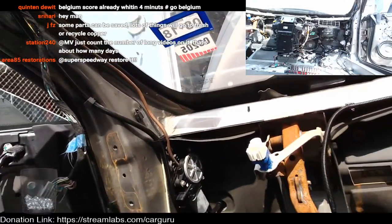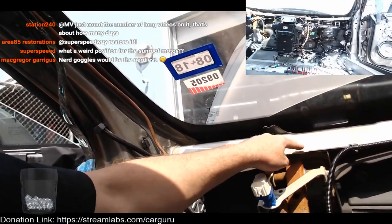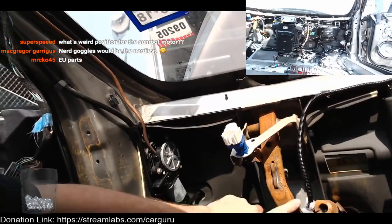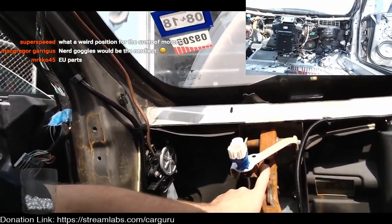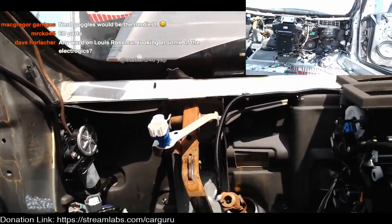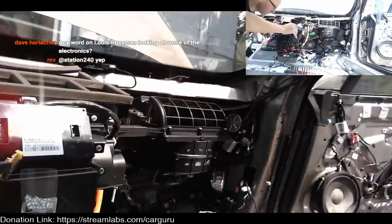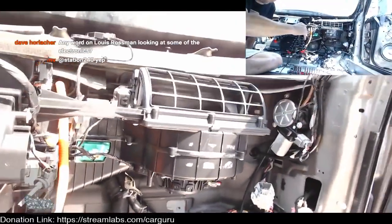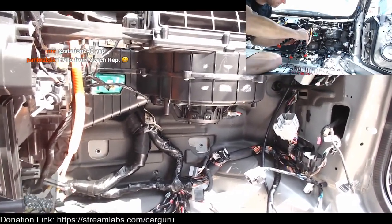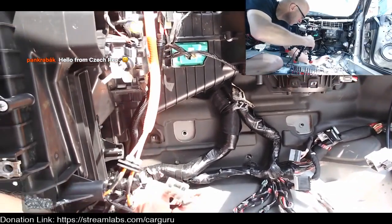One thing Tesla didn't do was keep on painting up here so you could see how far we had the water. We had water halfway up the windshield, and this rusted, but this didn't. So we're going to have to take this off later, quickly sandblast it, and paint the whole thing, just to protect it, stop the rust, make this thing last 20, 30 years. If this helps anybody in the future with diagnosing, repair, or whatever, hope this helps out. If I can actually hold the camera steady. No corrosion at all.